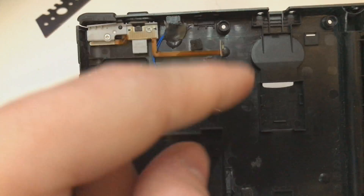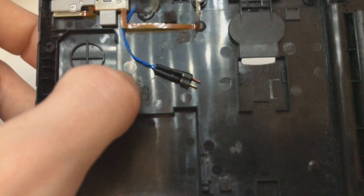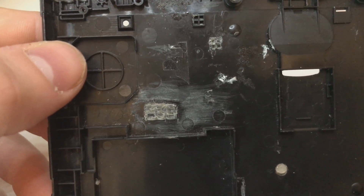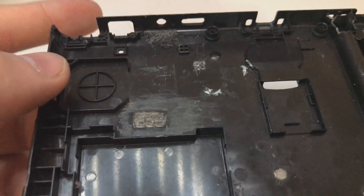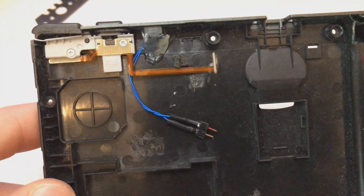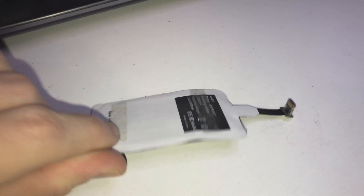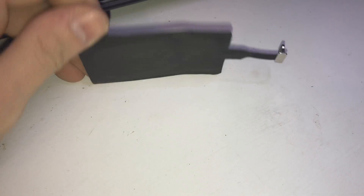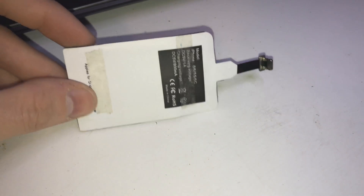Next step will be to place the receiver coil. To make the wireless charge receiver fit properly, you have to sand down this area and this one - I'll show you on my older one where you can see it better. It's ground down here and there. I use my Dremel for that, and it doesn't need to look pretty as long as the receiver coil can sit alongside the rest. Once you get a receiver from eBay for wireless charging - this is an iPhone one, though I used the Samsung S5 version - I have this one laying around to show what it looks like assembled.